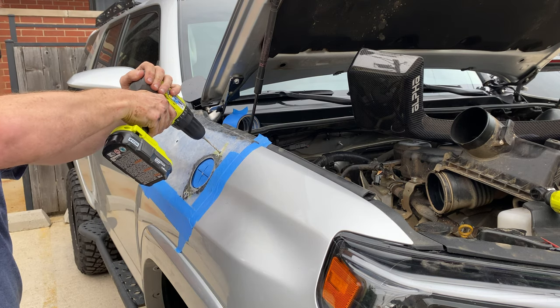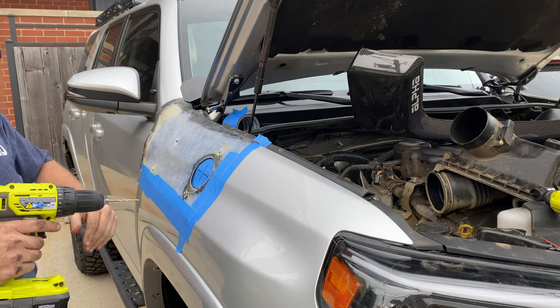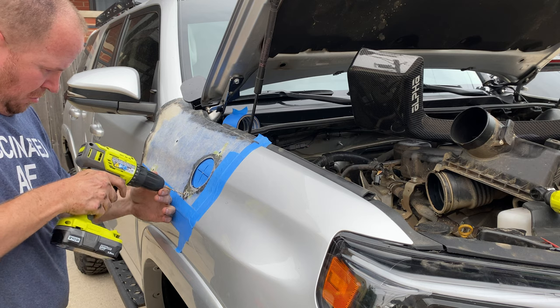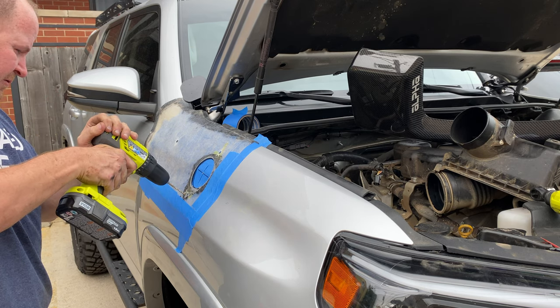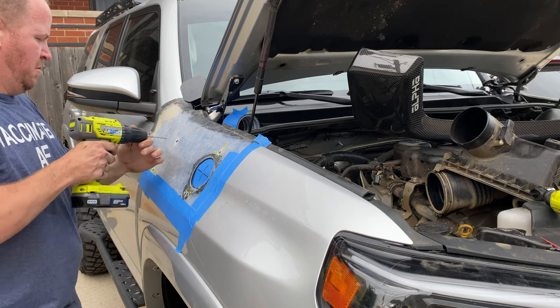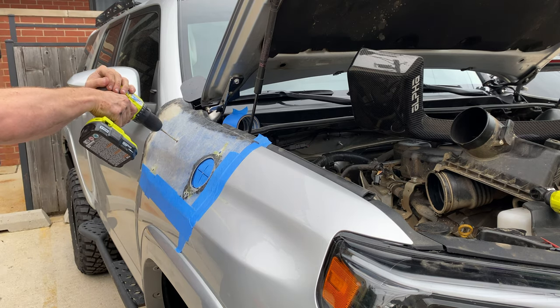So I did that to help make it easier. I started out with a smaller drill and I ended up going to the bigger one, as I'll talk about here in a minute. So I just want to put that in there, just let you all know. Basically just cover the whole fender area with masking tape, that way when it cuts it won't jag it, keep the jagged edges down. And then tape the template on and then proceeded to do the drill as we're showing here.